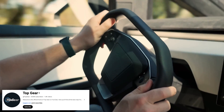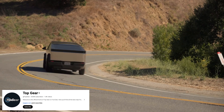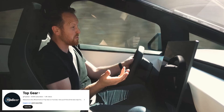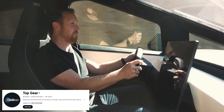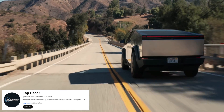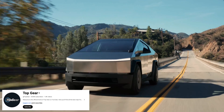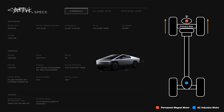This is my anticipation and judgement, and I will reconfirm it once the truck is available. Differential locking in electric vehicles can be achieved in multiple ways, which can impact the experience. On the face of it, this looks like a significant feature for what is essentially a work and lifestyle truck. The Cybertruck seems to achieve differential locking via a simulation driven by its brakes — again to be confirmed after actual experience. I am leaving links in the description for those wanting to read more on this.